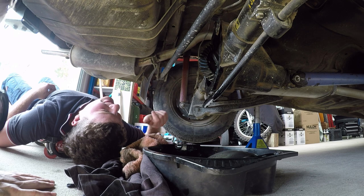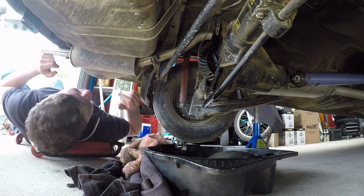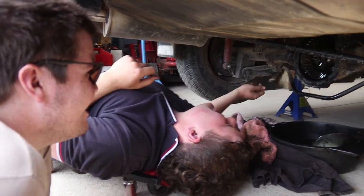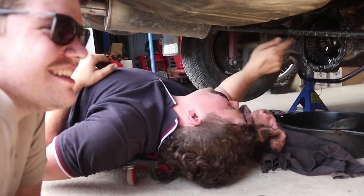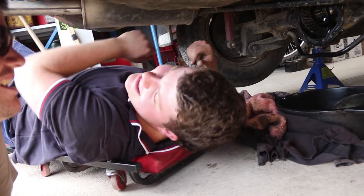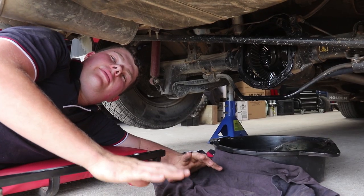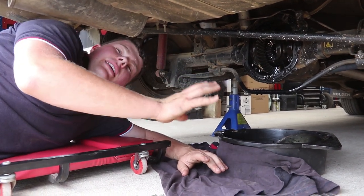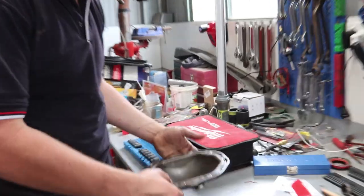So it's important to weld the gears before you start. The lesson here kids is: weld the gears before you start. Borrow your uncle's stick welder — I knew a guy that just pulled the filler plug out and jammed an arc rod in there. Anyway, I've had a quick look over them and nothing seems too bad, it's only a quick look. We're going to go ahead, clean that up, reseal the rear cover, put it back on, and refill the diff.